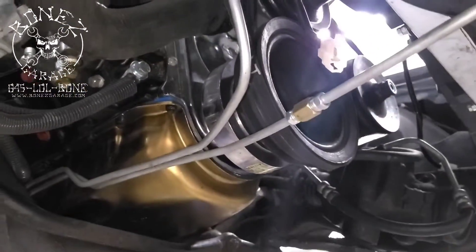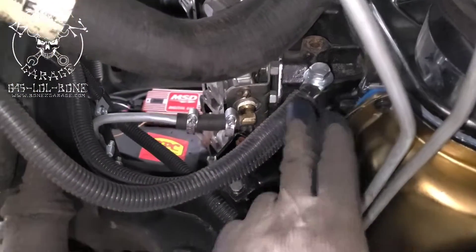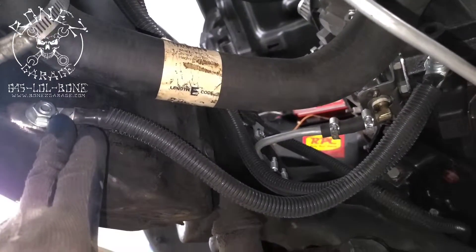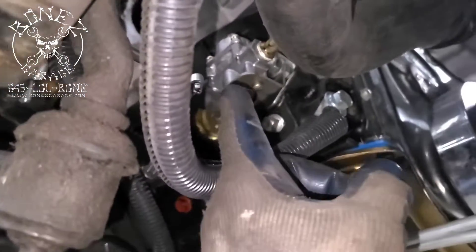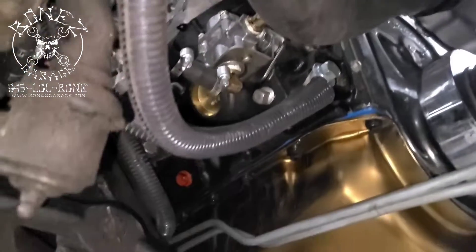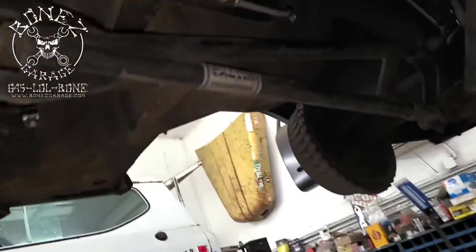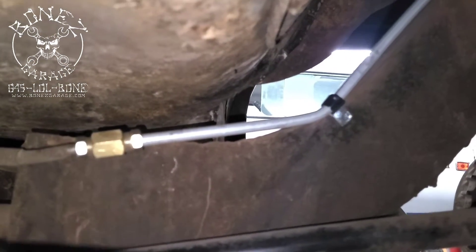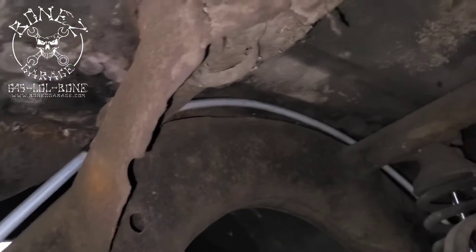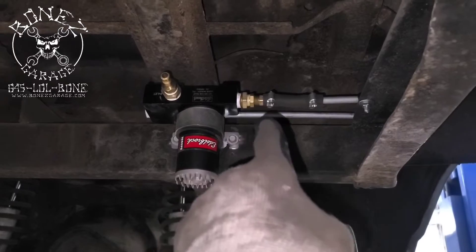You'll see how nice they run. There are the cables for the grounds going to the frame right over here. We also have the fuel line that we just ran, and we put the fuel regulator where the fuel pump used to be because we have an electric pump on the rear. I've also run a new line going over where they narrowed the frame — you can see the union right over there and the fuel line goes up over the frame rail.